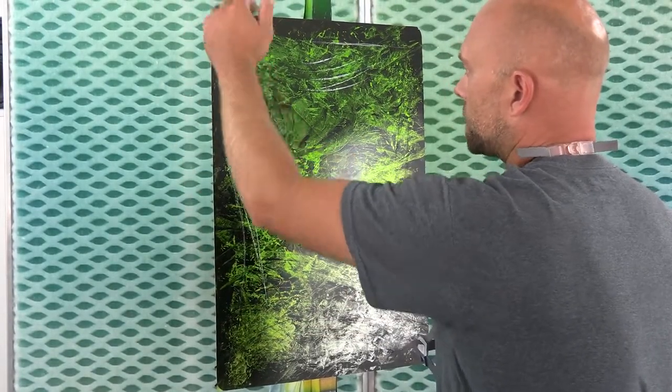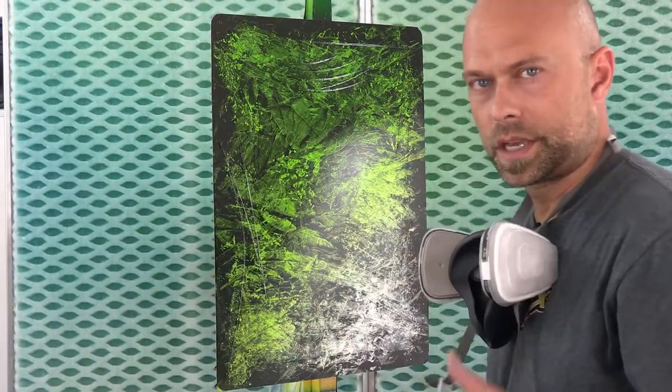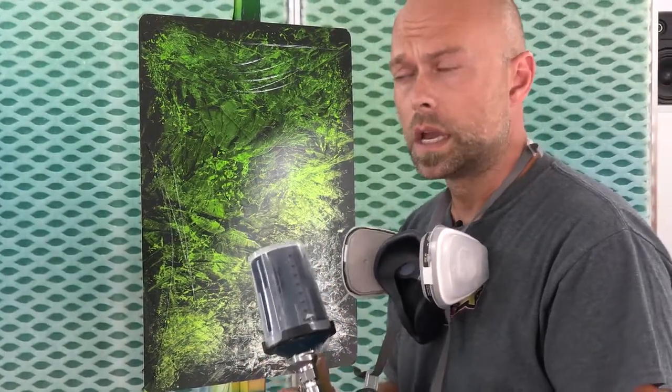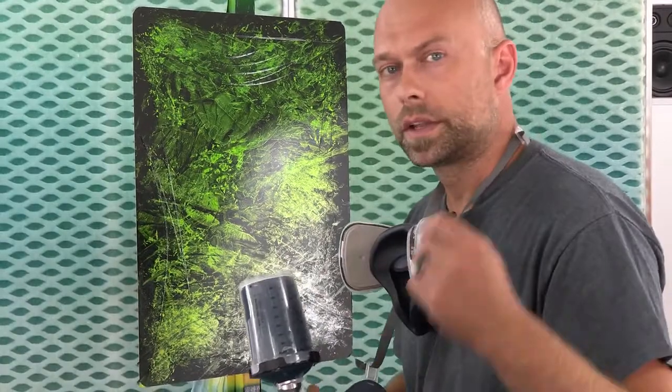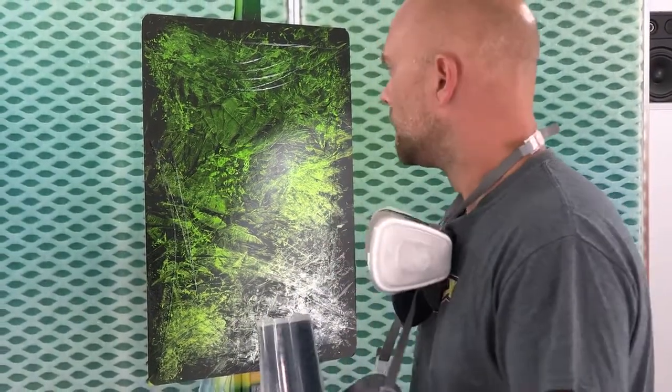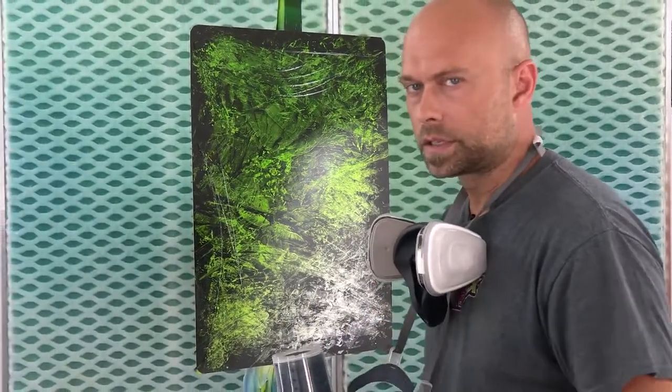That is key, especially when spraying the candies, because you're using your 40-50, like we always recommend now, the 40-50 with our candies. So dry to the touch is key. We don't want to do a wet on wet because it's just going to cause a lot of problems. So wait a little bit longer, 5 more minutes is going to make a huge difference.